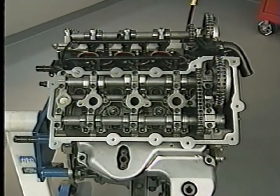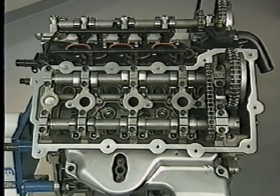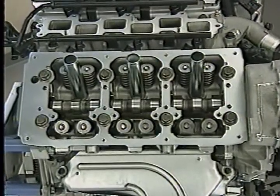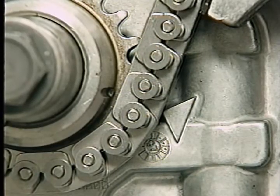Although all of the engines use overhead cams, the 2.7 liter engine uses separate cams to actuate the intake and exhaust valves in each cylinder bank, while the 3.2 and 3.5 liter engines use a single cam for each cylinder bank. It's important to keep in mind that none of these engines is freewheeling, and that proper valve timing is critical to avoid valve-to-piston contact.